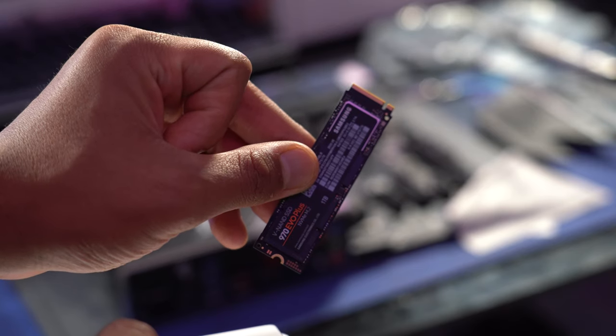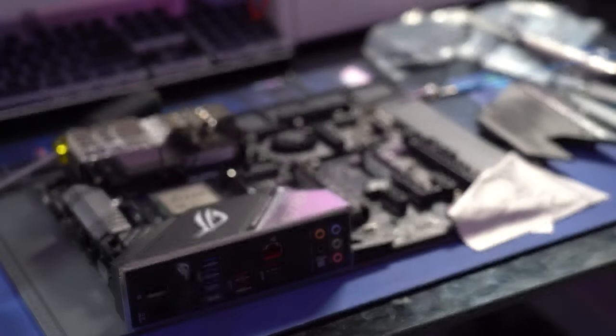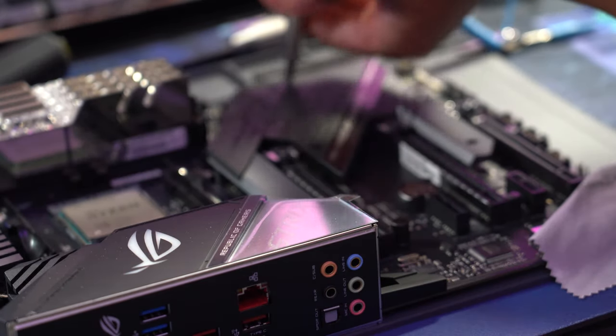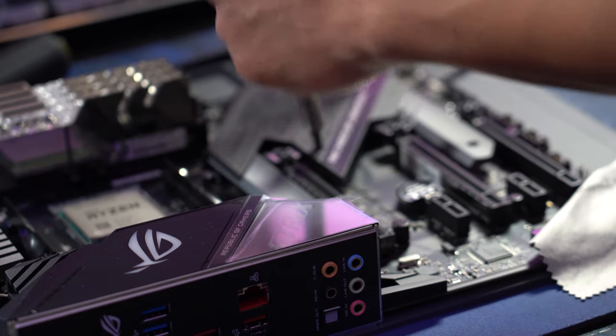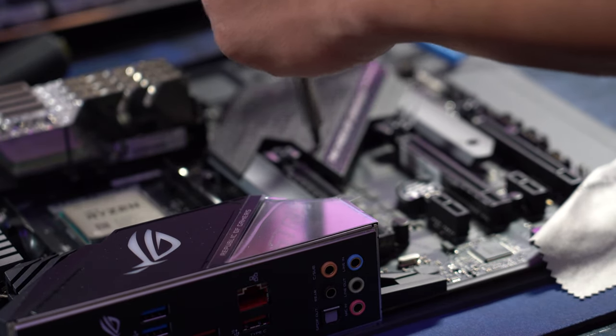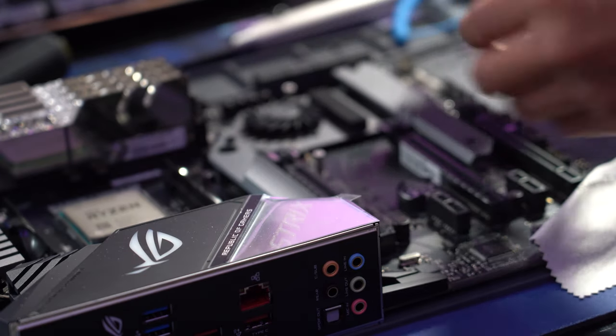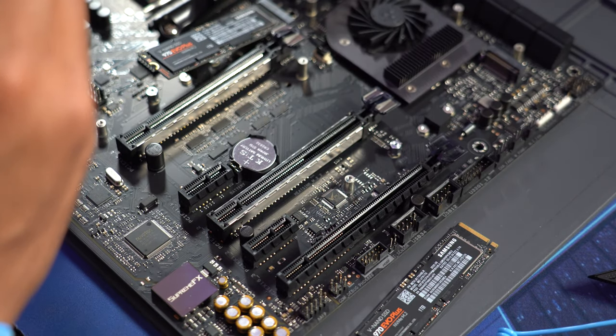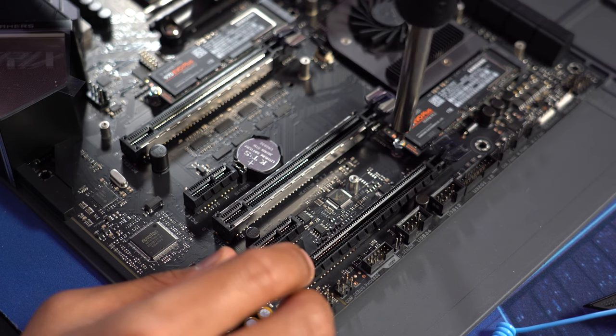I'm most likely going to be running my OS on a SATA SSD to hot swap into my new system without a new OS install. However, I'm moving to NVMe for programs and media storage. NVMe was new to me — when looking at ways to resolve my playback and render issues in Premiere, I learned that NVMe is almost four times faster in read/write speeds than SATA SSD 3. In my current computer I'm running two 250GB SATA SSD 3 drives, and I'm constantly deleting and using external drives. This time around I'm going with two 1TB NVMe sticks so I don't have to deal with storage gymnastics for every video I'm editing.